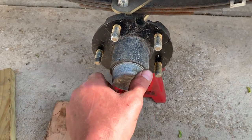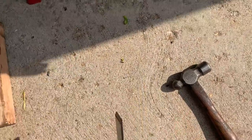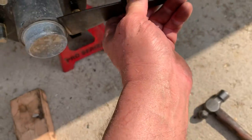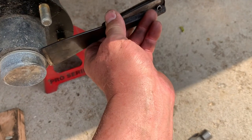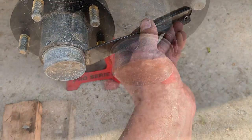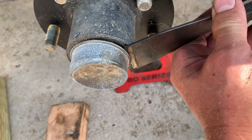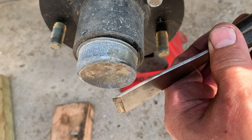Tires are off. Now you need to remove the dust cap. What I'll do is use a gasket scraper — my best one — put it right in there, tap it with a small hammer to get it separated. Then I'll take my scraper, get it in, and as I'm hitting it I'll angle it and it pushes the cap all the way off.